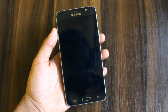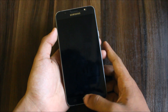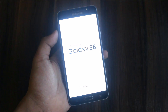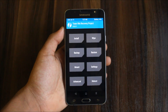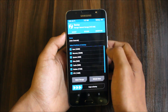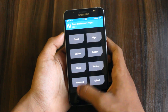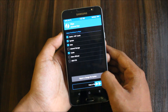Our first step is to boot into TWRP recovery mode by pressing the volume button, home button, and power button. If you are not understanding some of my words, please write down in the comments so I can improve. Go to wipe, then wipe system, data, and cache. Before doing this, go to backup and take everything — back up to internal storage or SD card — then go to wipe. No need to wipe internal storage or SD card.